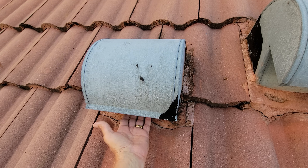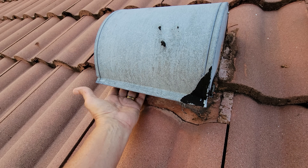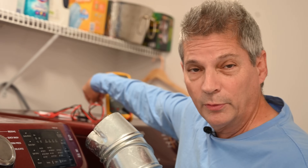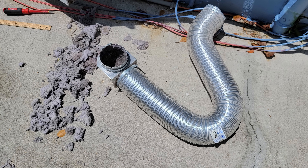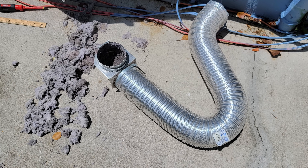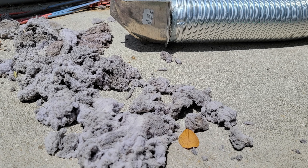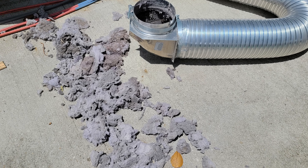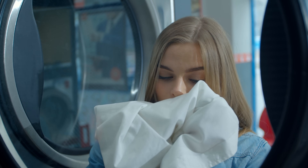When you come up onto the roof and put your hand under the gooseneck vent, you should feel warm moist air gushing out. Also check the ducting behind the dryer going from the dryer to the wall. At our friend Tina's house, her dryer wasn't drying clothes. I vacuumed out her whole duct system, all the way out to the outside vent, and we pulled out enough lint to fill half a trash can. Once cleaned, her dryer ran perfectly smooth again.